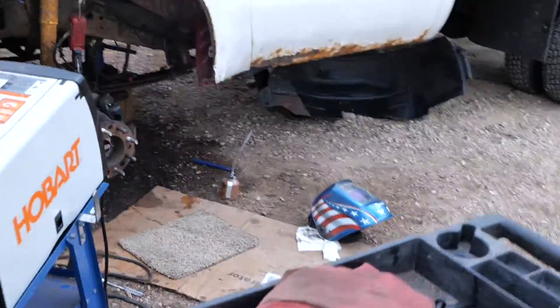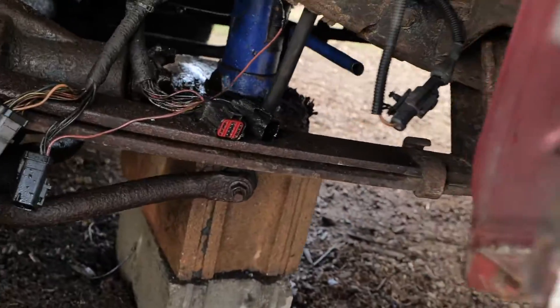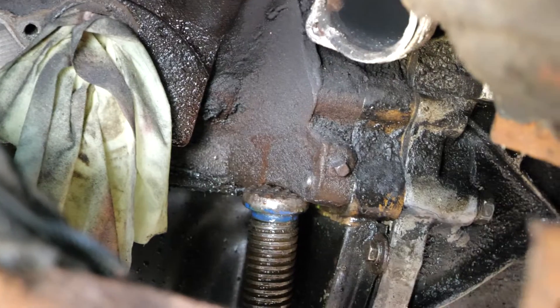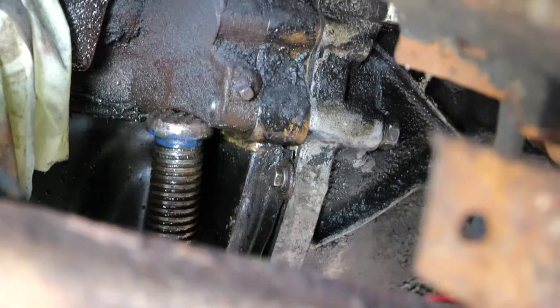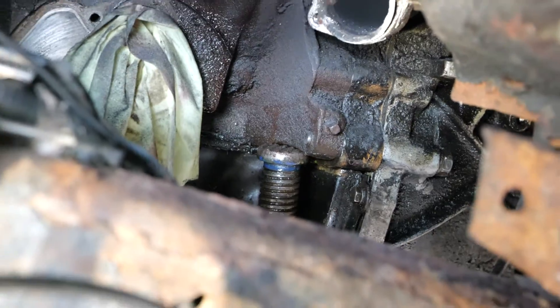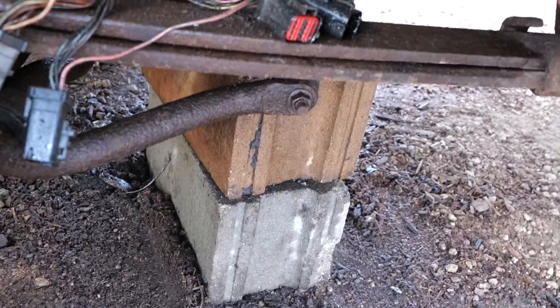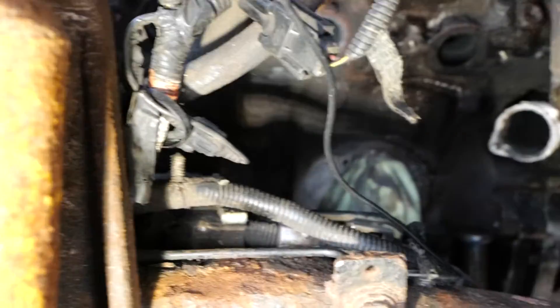In terms of jacking up the engine, I took some cinder blocks and a bottle jack and jacked up off of this point right here — you can see where I jacked up — just in front of where the bell housing bolts on. It seemed like a structural part and there's nothing else really to jack from. My regular floor jack wasn't tall enough, and I didn't want it up on blocks because it shifts laterally when you're jacking. The bottle jack worked well.